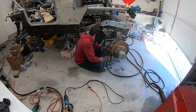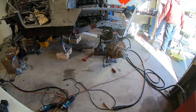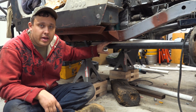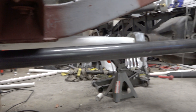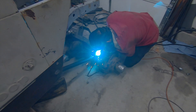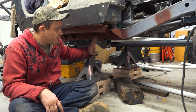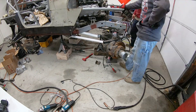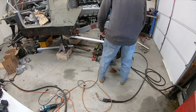A previous owner had built this into a buggy, then cut all the mounts off and sold it as a bare chassis — that's how I bought it. There were some mounts here where they probably had their lower link mounts, and I personally didn't want to try to mount over top of that plate and weld onto there. So we went right past those with our frame-side mount, kicked them out a little bit knowing we'd have some angle on the link arm, and it worked out really nicely.